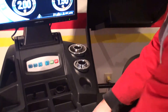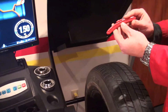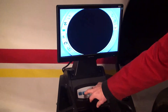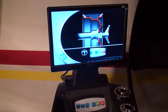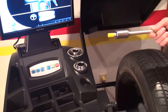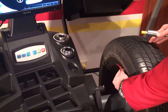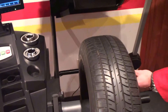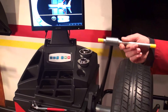For all previous machines you will keep using the hundred gram or three and a half ounce weight. You will go through the same program — pick up the dimension of the wheel first, go to settings, go to calibration, enter. Do the first spin as before. For the second spin, instead of the slug, place the hundred grams or three and a half ounces where the machine asks. The third spin will be with the hundred grams or three and a half ounces on the outside. So it is basically the same procedure, but using that weight instead.